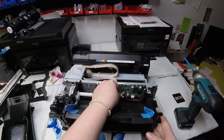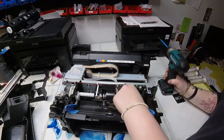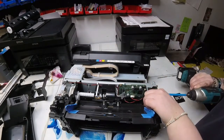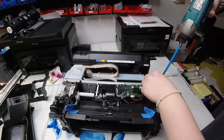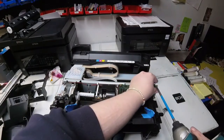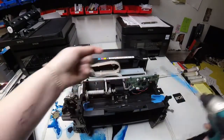I'm working on just detaching some FFC cables. There's going to be three screws in the main board — one in the middle and one on the right and left corners on top. There's also this little metal plate that connects from the main board to a plastic part on the printer. It's just easier if you take that off instead of trying to wiggle the main board out of it. It's just two screws that hold that little metal piece. Here are the other two screws that hold the main board in.